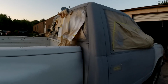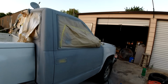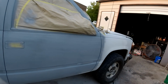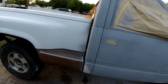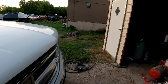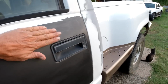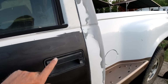But okay, I think I'm gonna end this video on that, guys. We stripped the whole roof, got rid of the rust, primed it, did some Bondo work here. Next video, we're gonna fix the fiberglass areas on the bed and strip this door down and do the body work. There's one big dent here, and then this here is caved in right in here. I pretty much know what happened.